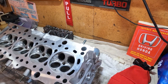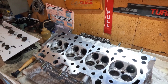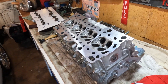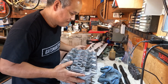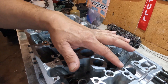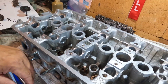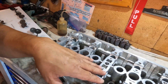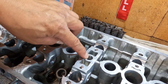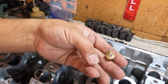For me, I'm going to replace those springs anyway and put new ones in — I'm still waiting for the mailman to show up, the computer says it's going to be here today, as is the head gasket. Always make sure there are no nicks or damage from the machine shop after you pick it up. If you source a cylinder head from someone else and don't know its history, always make sure you have the restrictor that goes in here at the center.